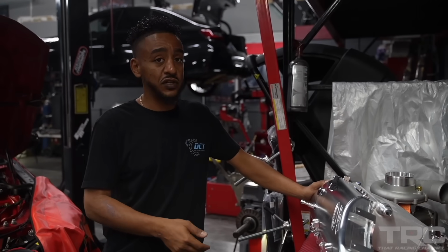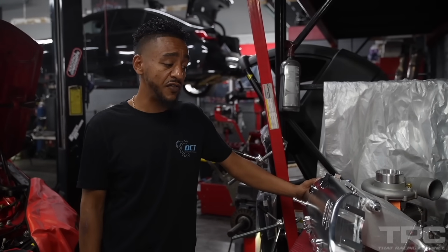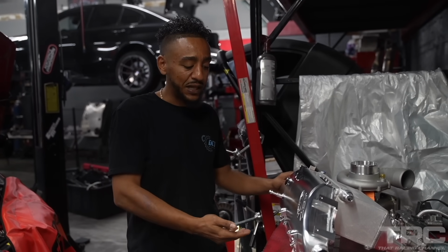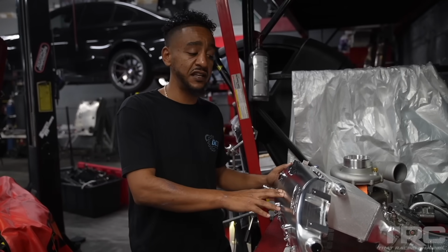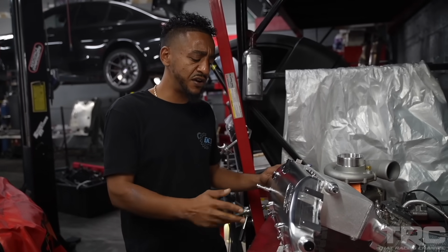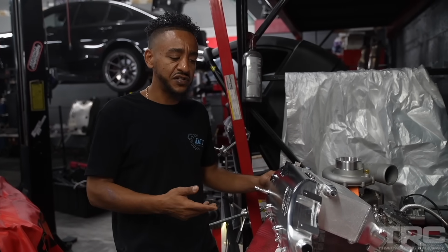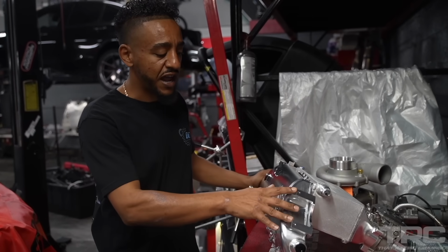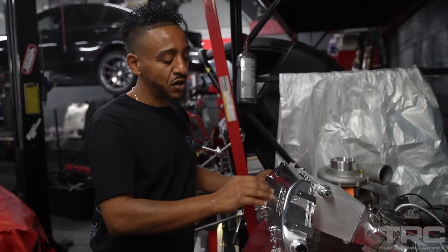This intake manifold is one of the most complete hardware kit intake manifolds available on the market. This specific intake manifold is going to come with that plastic intake plenum to keep heat transfer from the cylinder head to the intake manifold away. A lot of other intake manifolds come with a pressed cardboard gasket, versus this one will come with a true thermal gasket. As well as here, you're going to have brackets that clip in the factory harness, so you get that nice clean OEM look.